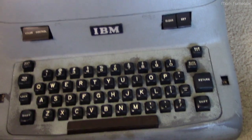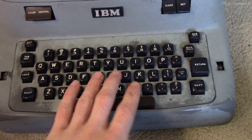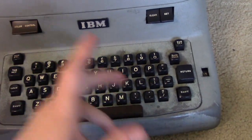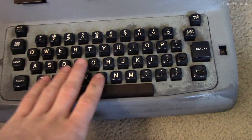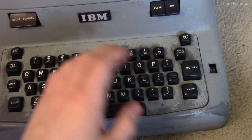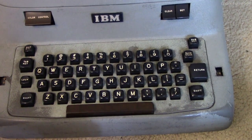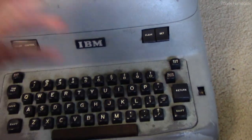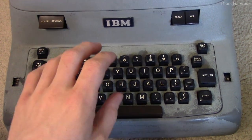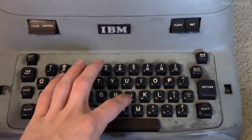It's very easy to press these keys, though it takes a bit of getting used to. With a typewriter you immediately think you've got to press really hard, but it doesn't matter at all how hard you press — whether very lightly or really hard, it does not change the output at all. That's really awesome, and I can see why IBM's advertisements promoted it as the easy way to type — it's just like typing on a computer keyboard. The key feel when they bottom out is very good, and the key repeat mechanism is interesting: you press and hold the key down, it won't type more letters, and when you release it there's a tiny little metal catch which re-engages the key.